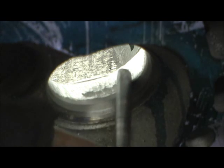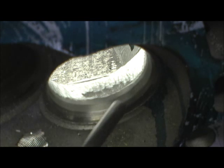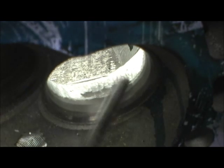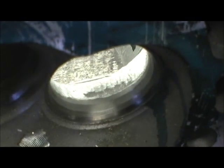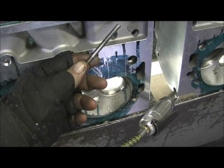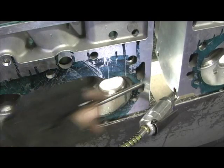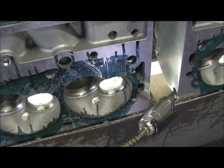I don't know if I can get it all or not — it depends on how much seat I'm able to safely remove. I wanted to point that out because had there been enough aluminum in the head — and this was true on every one of these seats — all of them had that horrific overhang of seat over the aluminum. Whenever you lay the grinder in, it would have touched that. It makes me have to go in and hit it, which I'm not going to do with the grinder. I'll go in with the carbide after I complete the valve job and retouch that. On the back side of the bowl there's plenty of meat — wasn't a problem, didn't have to touch the seat. That's a core shift situation — more meat going one way than the other — and it affected every seat.